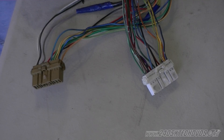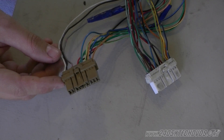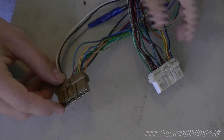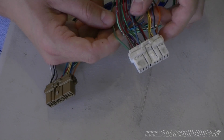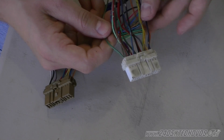That's not totally true as far as color for color, because on the dual overhead cam harness you have a black wire which is a ground, whereas on the single overhead harness you have a black wire but it goes for data. The single overhead cam harness does not have a ground wire on the dash plug.